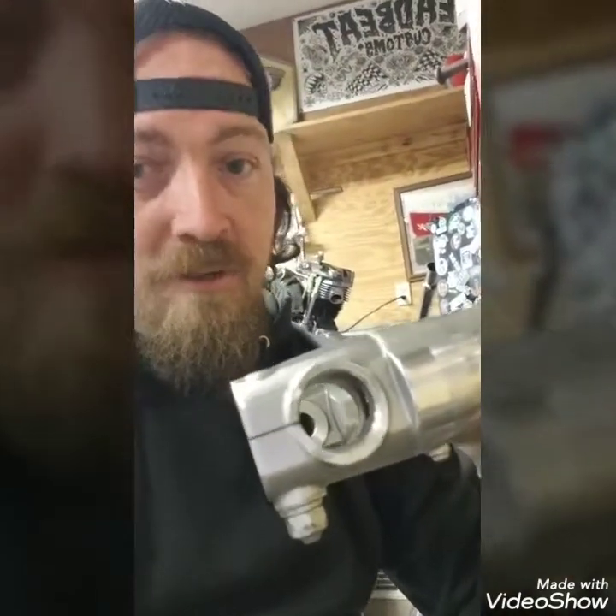The lowers I got last time are the one-inch lowers, aka sliders for Sportster. Sportster comes with two sizes: one-inch for the later years and three-quarter inch for the earlier years. I'm using the earlier years mostly because that's what I have parts for, and because I ordered the three-quarter inch axle spoolie.